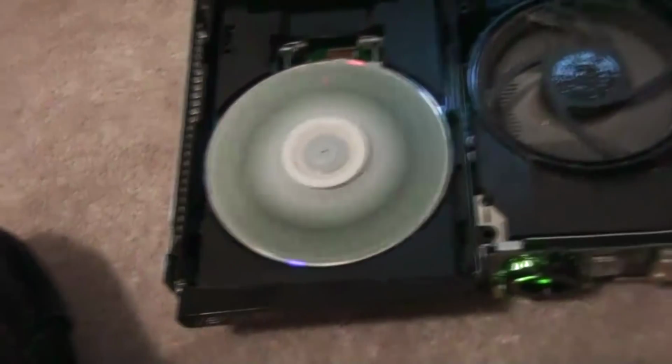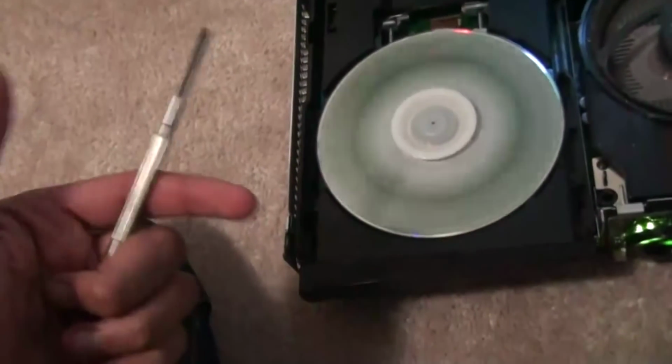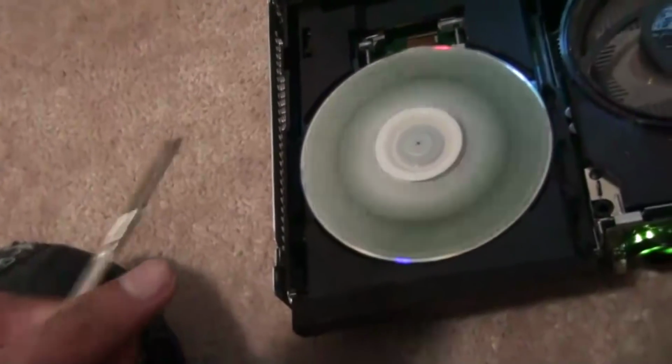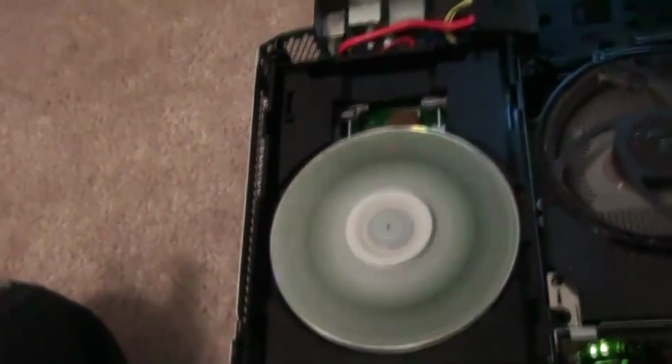So you're gonna take those 2 screws I showed you, and you're gonna spin them counterclockwise by 40 degrees, 90 degrees, and just if it doesn't work with the first screw, put it back and do it with the other screw, and try different combinations, and that hopefully will fix your problem. If it doesn't, then it's your disc level, which I show you. There's 2 screws here and there from the other side. You just have to manage to keep one side higher than the other.